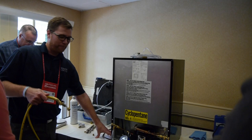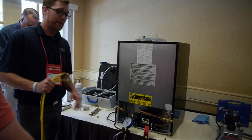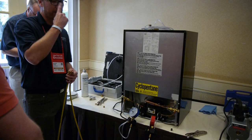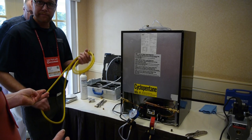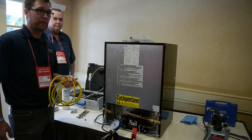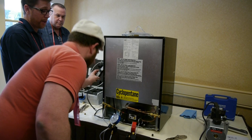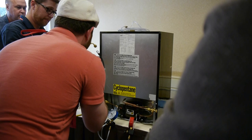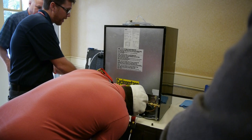Keep in mind that this leak detector can detect leaks less than 5 grams of refrigerant per year — it's an extremely sensitive and finite leak detector. You can put it up to the foam and check, because the insulation contains cyclopentane which is a flammable gas. I've yet to have it trigger off any of that. Going back to the hose — shaking it around a little bit, the small residual refrigerant even from a hose that was under vacuum will still cause it to react when doing small disconnects between connections.